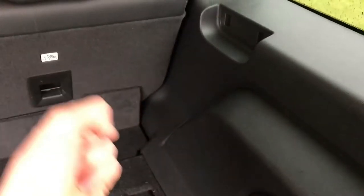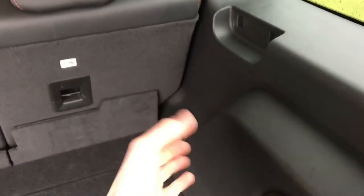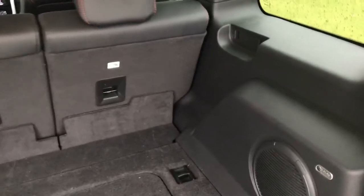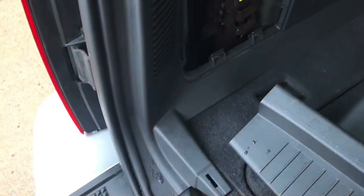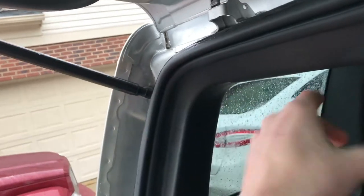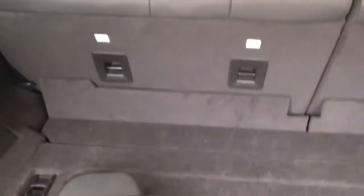Pop this panel out all the way — there's a clip by the footwell or wheel well, pull that out, and you should be able to pull out the entire panel from the car. The easiest method: you will have to remove this upper panel first. The half-moon piece has a screw in it — pop off the clips and you can have it free hanging. Exact same thing on the other side: remove the cargo tie-downs, pull down here, pull up here, get that panel off first, and then you can pull out the entire panel when the seats are down.